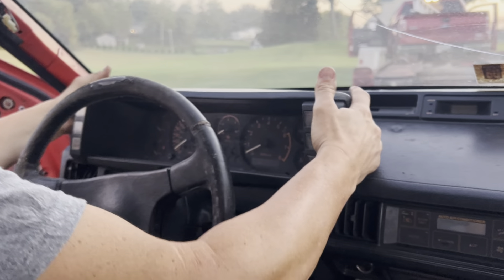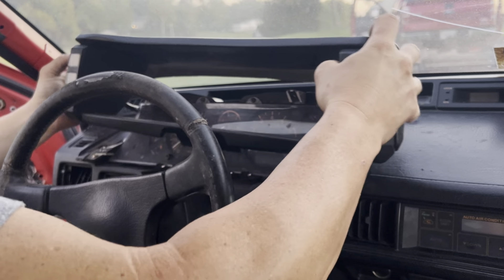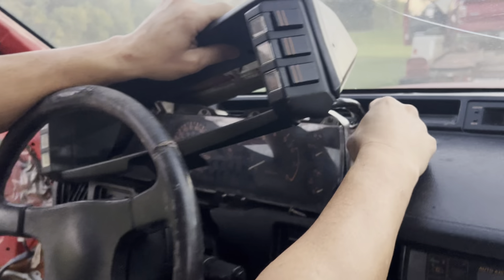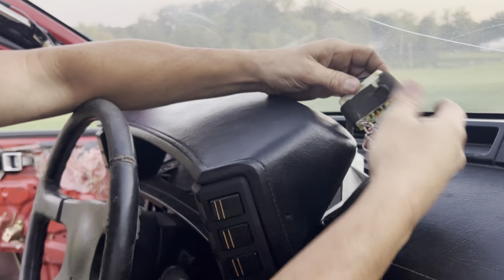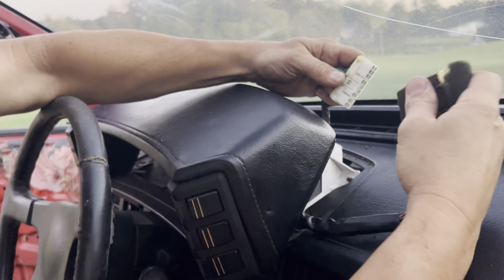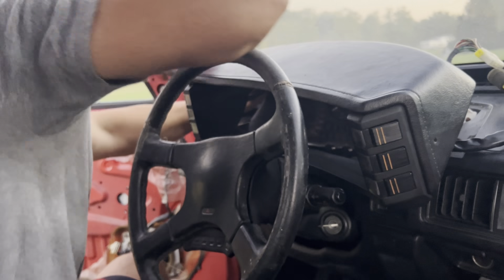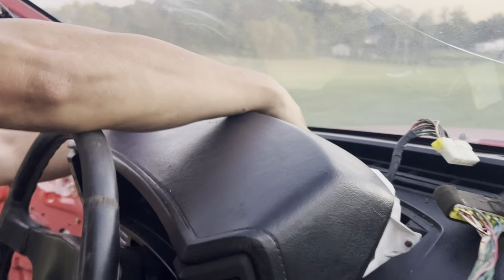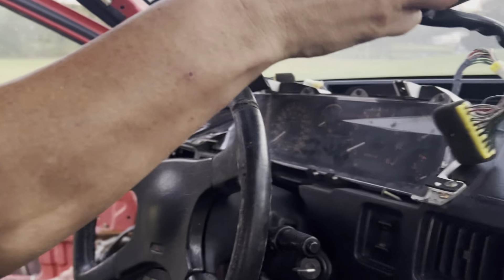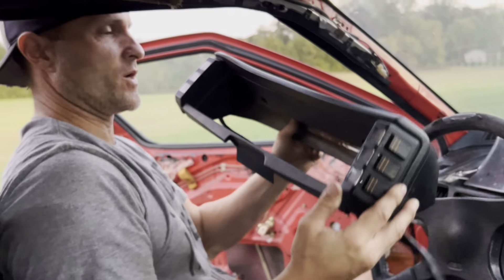You're just going to basically shift it around a little bit. You have two cables — harnesses — going into each one of these light switches. Pretty easy. Pop these off, press that retainer, pop it off. This one is kind of tucked back in here — you have to untuck it from behind the cluster. Undo it. As you can see, like two and a half minutes and you've got your whole cluster off.